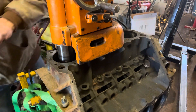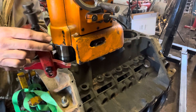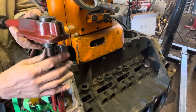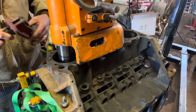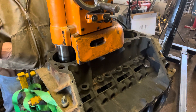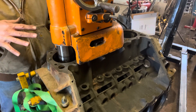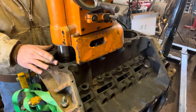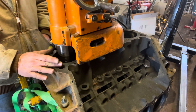I'm centered, but I leave it there. Then I've got this tool that goes in the backside of the machine and grabs onto the bottom of the cylinder — comes up here and this piece hooks right into there. Then I turn this and it locks this machine down onto the block. I've got this block on an engine stand, so I don't have a table, I use it this way. I bored a 350 Chevy out to a 30-over and made a stroker motor out of it. I'm going to get this tightened down and then I'll start setting up my cutter. We're only just trying to see how far we have to go to get the cylinder to clean up.